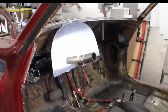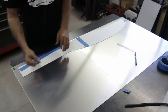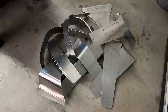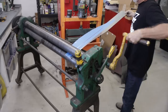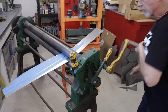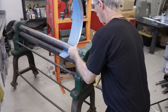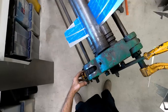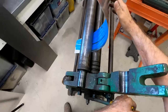I use poster board for all of my CAD work — it comes from Target. I made a bunch of practice pieces out of junk aluminum sheet. There are several complex tipping die bends that I thought needed a dress rehearsal. The final metal used throughout the dash is 63 thousandths 3003 aluminum. The tape on the aluminum is to keep the slip roller from marring the metal. 3003 is the softest aluminum, and 63 thousandths thick is thin but still not fussy to weld.